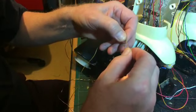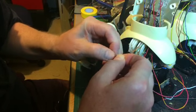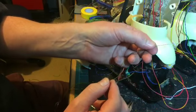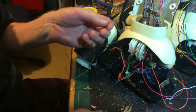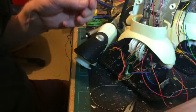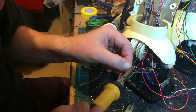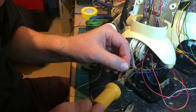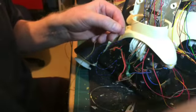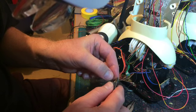Okay, and pull it out, and then I'm going to spin it. Hopefully make sure I'm spinning it the right way. Because as I say, I want that wire taut. So there we have it. Okay, and now what I'm going to do is to just pull up my solder. Some solder on my tip, and then about there I'm going to heat it and seal the wire.